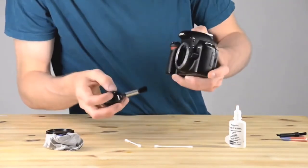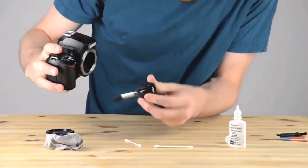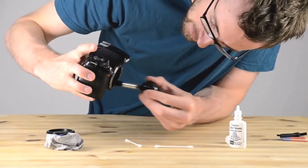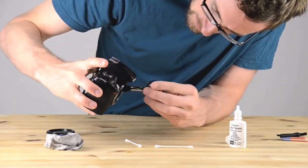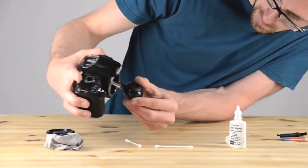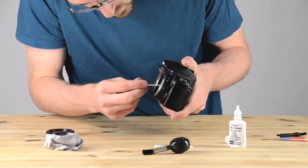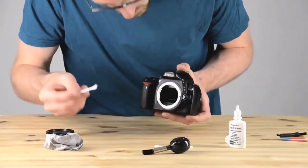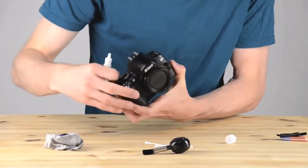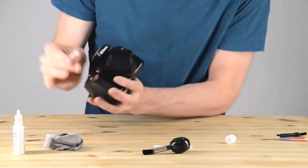Now I'm going to hold the camera up as before and brush off the prism on top. Right underneath the Nikon logo there's a flat surface with a prism that you look down through onto a mirror. Now I'm brushing the mirror off — both will get dust on them. Cameras are electronic things, so dust is attracted to them just like TVs, radios, and computers. Dust gets sucked inside as soon as you open the camera and sits on the prism and mirror, and sometimes in bad situations on the sensor. I'm going in quickly with a very, very lightly dampened q-tip to wipe off the mirror, using both ends to dry it off as well.